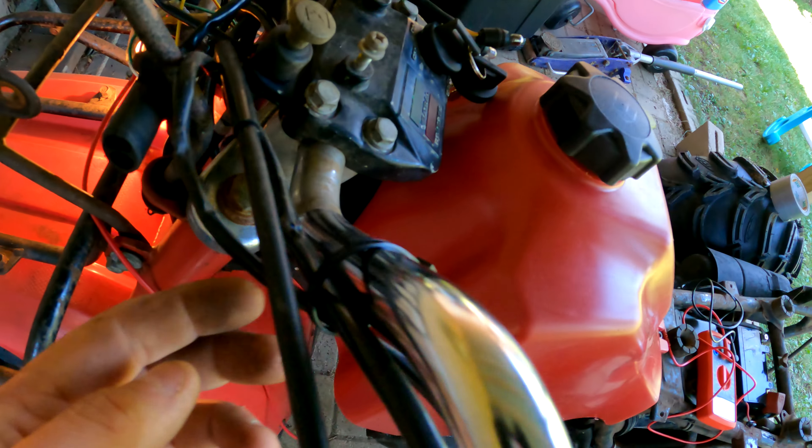The light works, the front tire seems to hold air, and there's a hitch on the back. The big thing was the electric start — it really wasn't starting. But it looked like basically just a couple of frayed wires. The neutral light is working and then — electric start works!